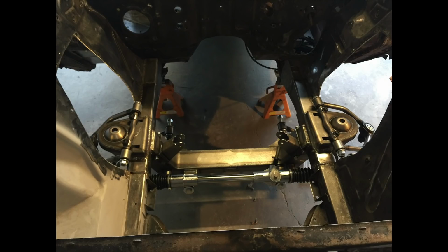I decided it was going to be a lot better to just slap a carburetor on it and get the thing going. Also, I wanted to update the steering and the brakes, so I welded in the Mustang 2 front end. Now it's front and rear disc brakes, 5x114. The rear is from a 1998 Ford Explorer, so that's rear disc, same lug pattern, everything. Now that's how the car sits as of right now.